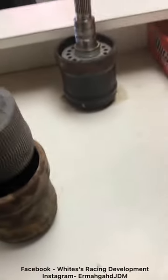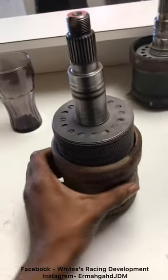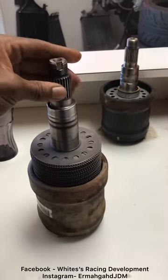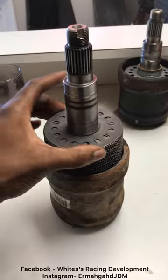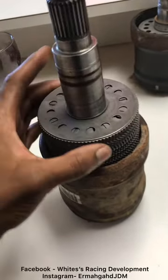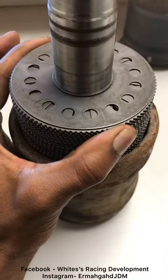So, the resistance of the discs spinning in the fluid effectively transmits torque to the rear of the car. There's no mechanical connection, there's no clutch, there's no direct link mechanically to the rear of the car. All of this is done by literally the shearing properties of the fluid. That's why you should probably make sure yours is right and not worn out or burned up or anything like that.